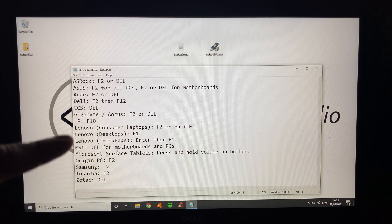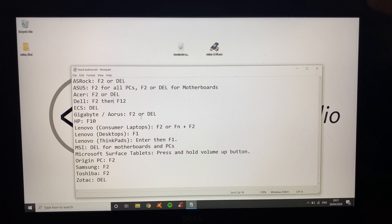Here's a list of all of the machines that you can boot into. I'm using a Dell so I have to press F2 on startup — it changes a couple of settings — and then F12. If you're not sure how to boot into a BIOS, then please just Google it. There'll be various websites and videos on how to do that, so you're going to need to boot into that.